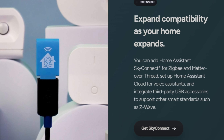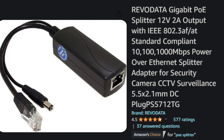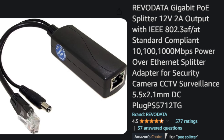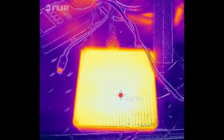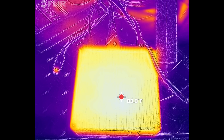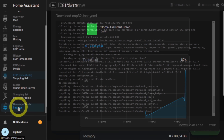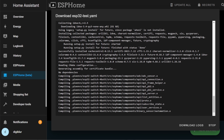There is no Z-Wave and no Zigbee on this, so you're going to have to add those radios. You can do PoE splitters if you really want to run it PoE, but that price continues to go up. Heat-wise, I checked on the FLIR — it was only running like 80 degrees Fahrenheit even after running a bunch of ESP Home compilations, which really taxes the processor. It's got a big heatsink and can probably work in some really warm environments without any ventilation.